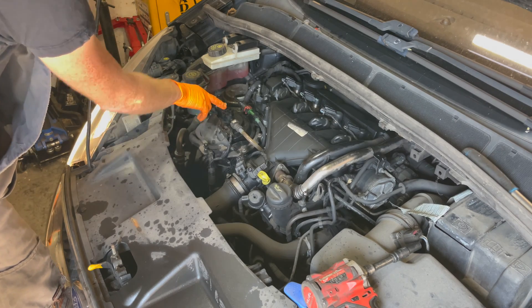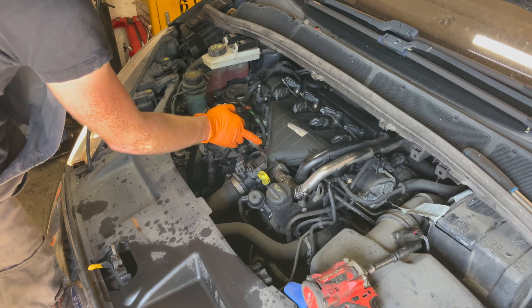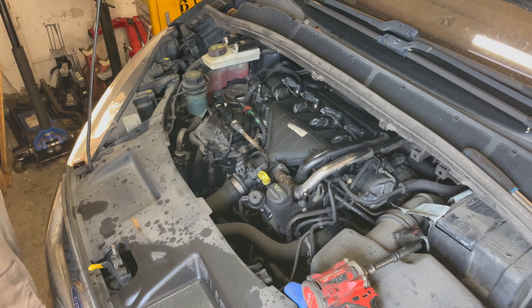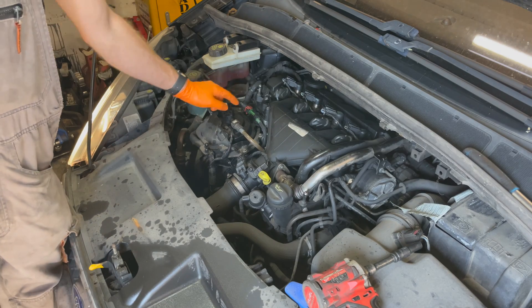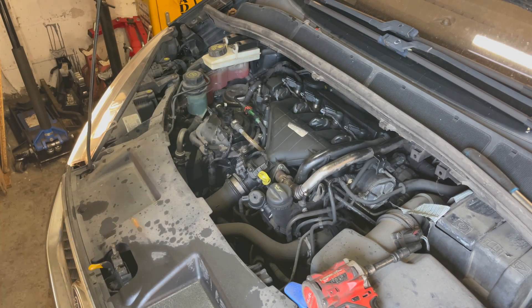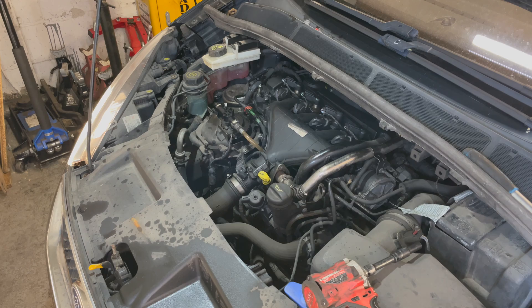Make sure this bleed nipple is tight so it's not sucking air in. No bubbles coming through this pipe here. Although it did cut out for a tiny bit — I think that was pretty good. Probably didn't quite leave the vacuum on as long as I should have, or probably would have if I hadn't been filming. And that's it — it's actually done, and that won't cut out now.